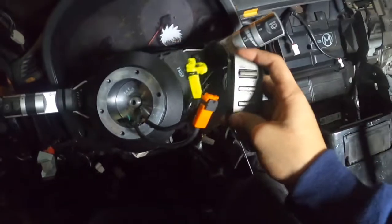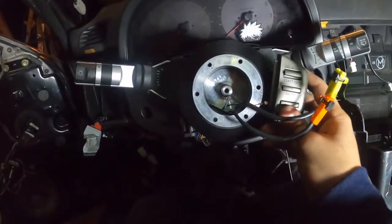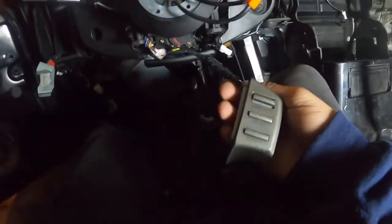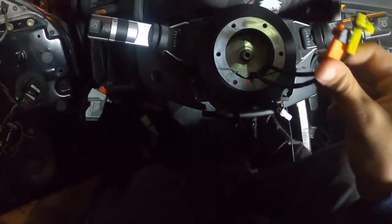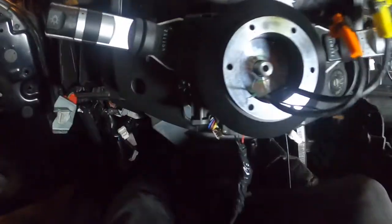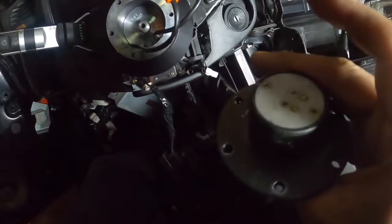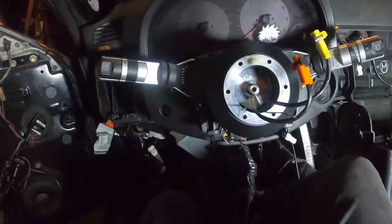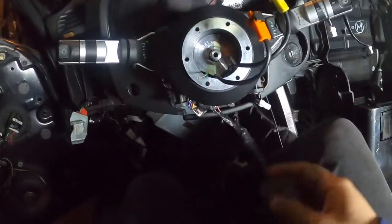I kind of just jankily wrapped it up — this is just temporary for now. I'm going to mount it right here on my steering wheel. There is a company that sells a little adapter plate that goes over this so it will bolt on right here — I'll drop the link in the description. I obviously don't have it yet, so I'll be zip tying it to my wheel. So you're going to have your cruise control right here, your green wire for your horn, your black wire as ground. The two airbag wires you can just tuck inside. These two wires will be going to the two wires that are on the inside of your hub adapter. I do have to find a horn because I don't have a horn in the car. I already tested these — they all work. The only main thing now is just the cruise control and my horn.